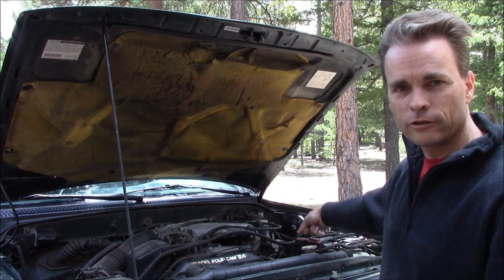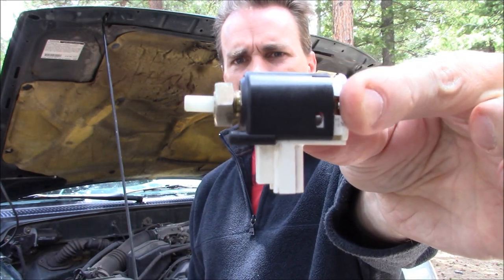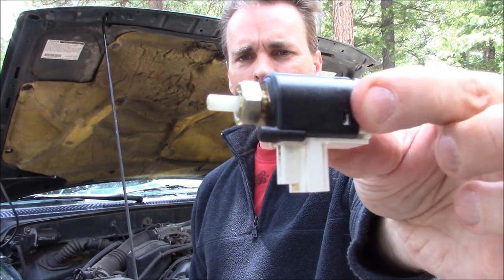I've got something else about the Tacoma here while the glue is drying on the charcoal canister. I was having a problem where I was pushing the clutch pedal and it wouldn't start. Then if I slammed the clutch pedal about four times, it would start. So I took out the clutch safety switch to see if I could perhaps fix it without having to replace it. I also have a clutch override button - clutch switch cancel or something.